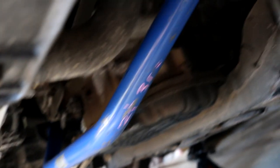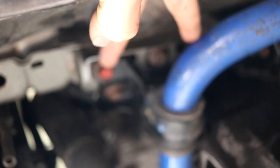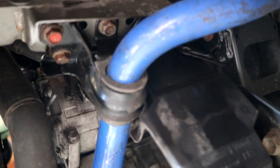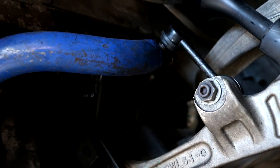Just like that, we have our new Cusco front sway bar in position. It was very simple to get back up in there — it only took about 20 minutes to get in position, all bolted up and torqued down. The torque specifications for the bracket bolts: the two outer bolts are 45 foot-pounds. The two inner bolts are 60 foot-pounds — torque those down for sure. The end link connection nut is also about 60 foot-pounds. It's important whenever you're doing suspension work that you use the proper torque specifications.